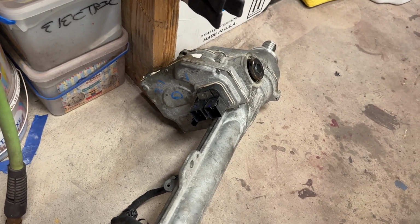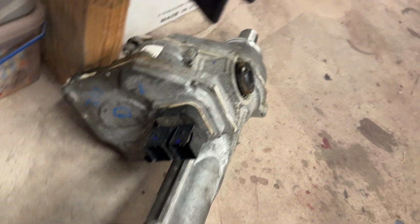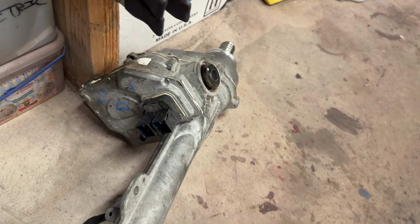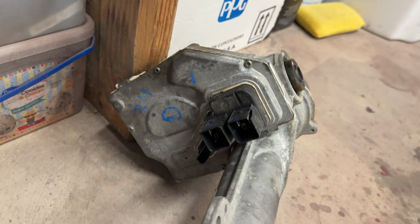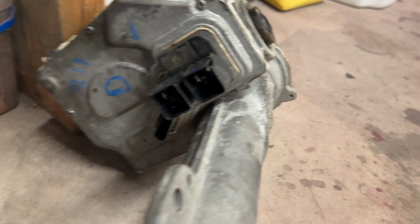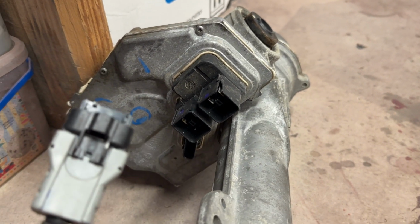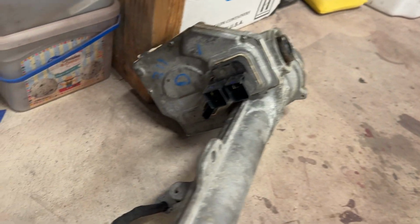And the answer is because that would get us around any bugs in the logic that Ford has in the ADAS signals. So I think that's where I'm going to start. I certainly also am going to try and solve this issue using only CAN bus signals, because if you solve the issue using only CAN bus signals, there's no need for an extra box, which is something extra to build or buy to build the torque interceptor.